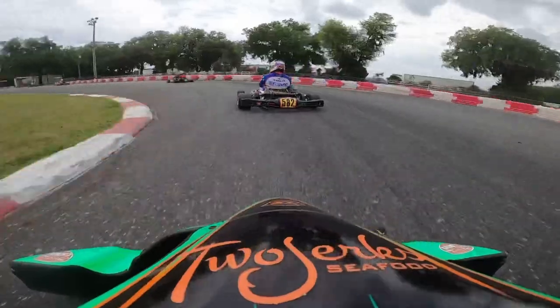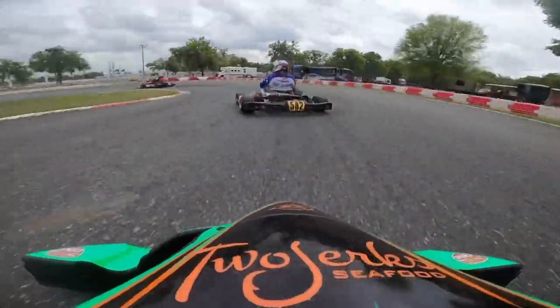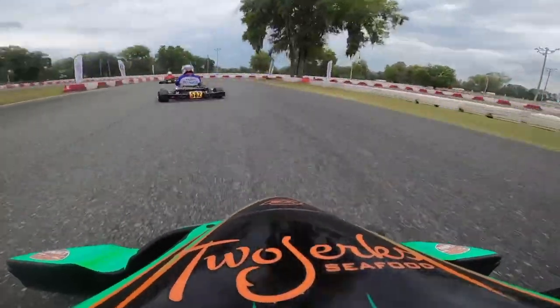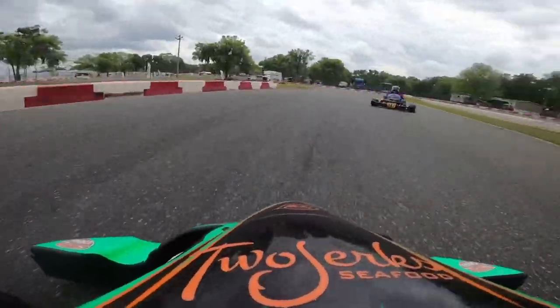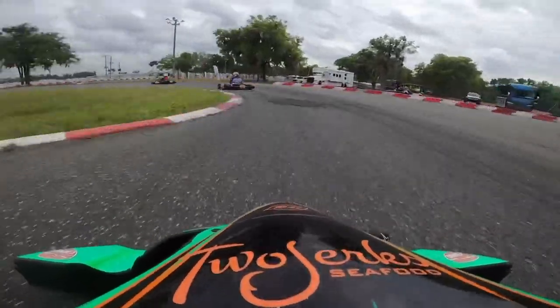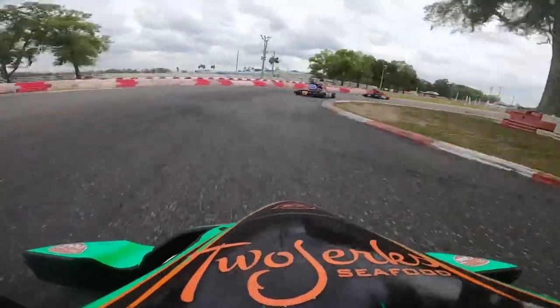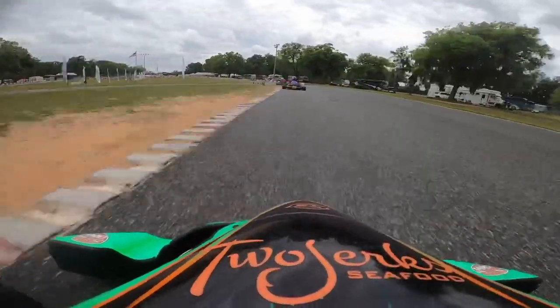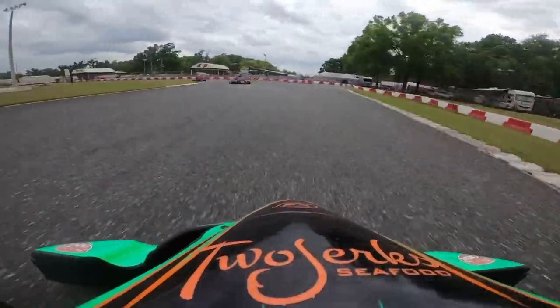That is my fault. There's these little caps and covers that came with the air box. I left them on because I thought that was helping for filtration, but that's not the way you do it. You take those caps off, and you put a little bit of grease on where the intake is for the air box, and that's what catches all the dust. So really the motor was cutting out due to my fault.